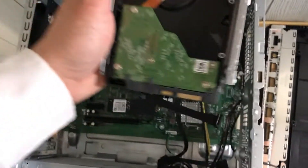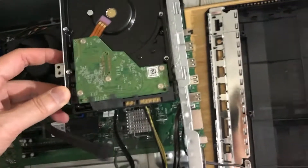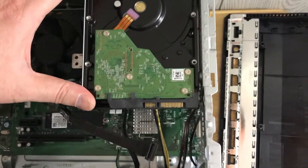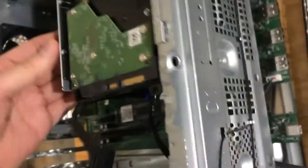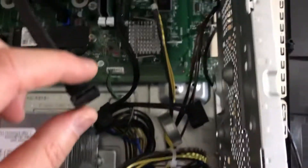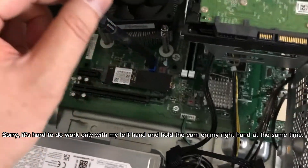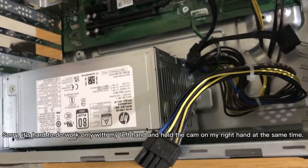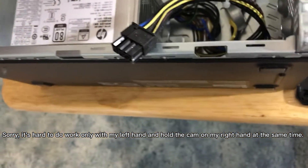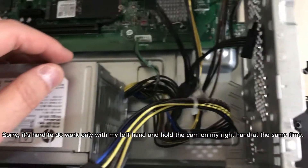Now I'm going to put this thing back the same way I took it out. Put this in — okay, that's it. It's not moving, which is good. I'll need to screw this screw back in to lock the hard drive bracket in place. But right now, before I do that, I'm going to connect the SATA cable to the hard drive. This PC already came with one SATA cable — it's super short, probably about seven inches. The power cable is this one. Let me connect the SATA cable first, then I'll connect the power cable.